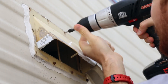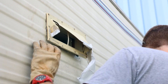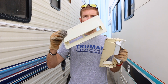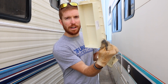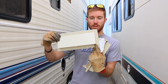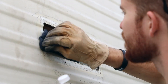For a temporary fix we put weather-resistant duct tape on it, but now it's time to replace the entire unit. We're going to take this off, clean it up, and get it ready for the new one we ordered. That came off super easy. Here's the old one and here's the new one we ordered off Amazon — it's just got that plastic flap in there that's supposed to stop bugs from coming in, and you can actually lock it down. I'm going to get this area cleaned off so we can install the new one. We've got butyl tape and some quad to apply.